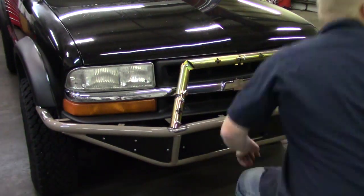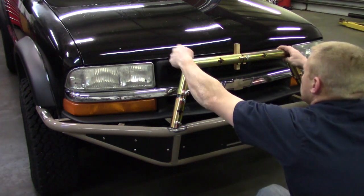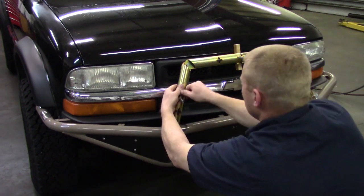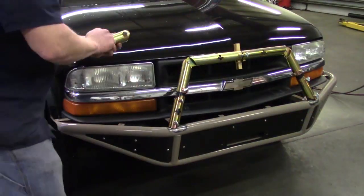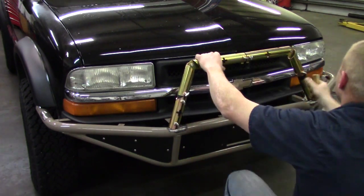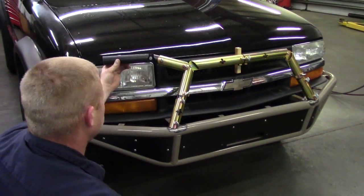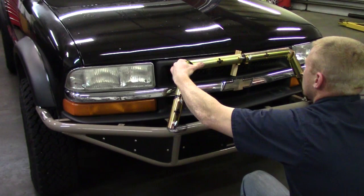Now I can adjust it to fit just right. I'll use a block to space it off the hood, tweak it around to where it's nice and level, maybe add a little height to it, and see how that looks. Then I can grab another piece and get an idea of where the headlight hoop is going to go. I don't like the heights so I can move it back down—that's another nice feature of the jig, you get to check things. That's looking better, but I want the cope right next to the bend, so I'm going to extend the center hoop a little bit and then knock it back down to where it's level.